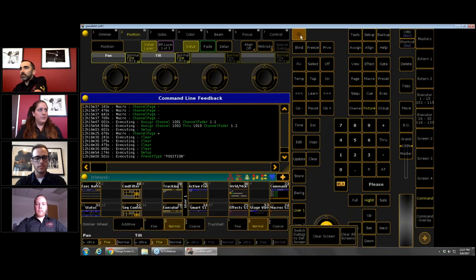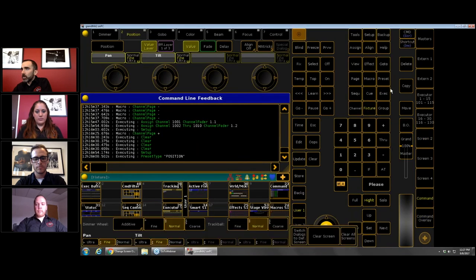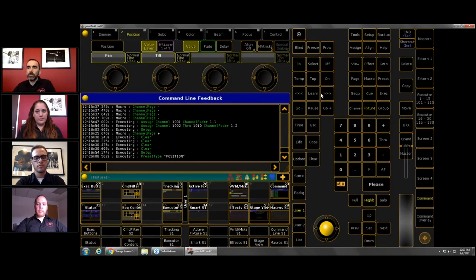And then on the console, this little screen button, make sure it pops up. A lot of times you use that to clear the screen. Come back, hold that again. You can disable, oh, it doesn't show up on PC, I'm sorry. There's another button here on a console that'll allow you to disable the little 9-inch screen. Sometimes people accidentally hit that, so just be aware of where to turn those touch screens back on. If the settings are enabled, reboot the console. Little touchscreen controllers are negotiated at boot up. If they continue not to work, then contact your local hardware tech.